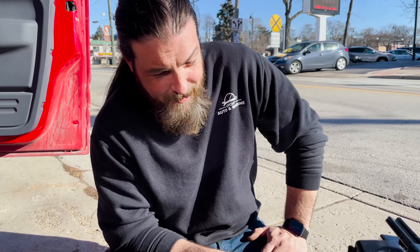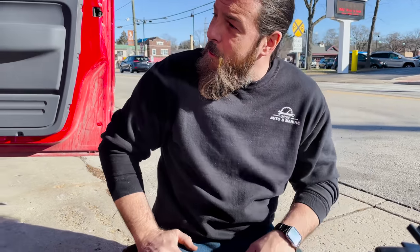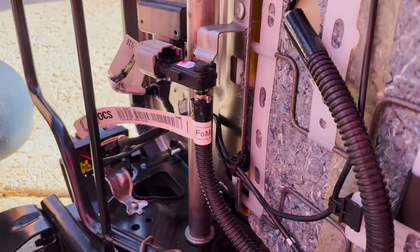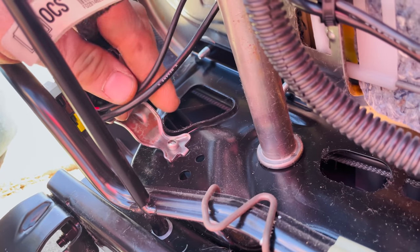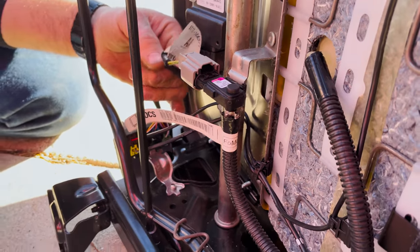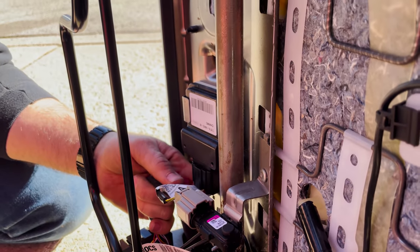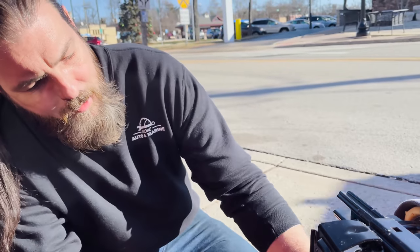When we're moving the seat, we now have the airbag light on. So in order to get that off, I am going to disconnect the pressure sensor and passenger computer. Everything else should be related to the seatbelt — it doesn't need to see that plugged in. So these three plugs down here — we're going to plug that back in and hide it, so the truck will still think there's a seat in there without a passenger.